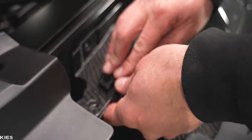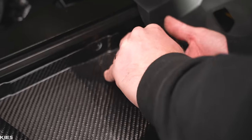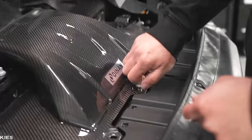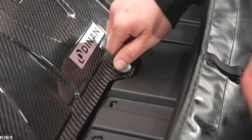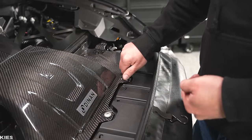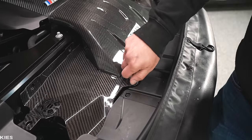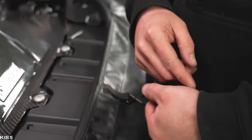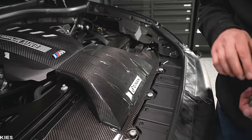Since we have that all good to go, I can start to reinstall some of these bolts, and we can also reinstall those two pieces of plastic that help the radiator not rattle around. Then you're going to take those T40 bolts that we removed earlier and carefully reinstall these. Remember, you are tightening against carbon fiber, so don't go too crazy — otherwise you're going to crack it. You may also notice that you have a bolt left over because since there's a gigantic scoop in the way, there's no longer a middle one on the top.